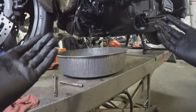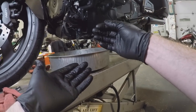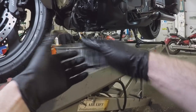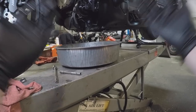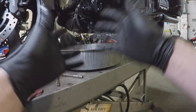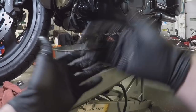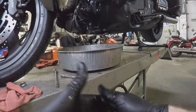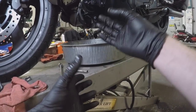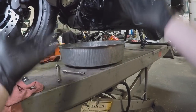Or if you want to go the extreme route, you can flush it out using either a couple of gallons of distilled water — fill the system up completely once it's drained, and run it to operating temperature. Once you run it to operating temperature the thermostat allows it to open, flush through the cylinders, get all of that mess out, and you can drain it — of course once the bike has cooled down. Putting it through that heat cycle will take an hour or two to really cool down. You can do that as many times as you want until it's clean — once or twice is usually good enough. Or for a little different type of cleaner, you can use a 50/50 solution of distilled water and white vinegar. A little bit of that acidity will help clean out any deposits left in the hoses and around the water pump. Again, operating temperature, wait for it to cool down, then drain.